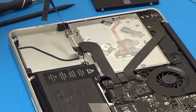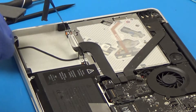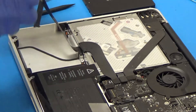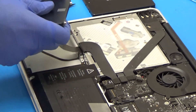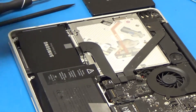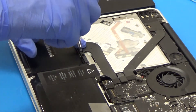In this case, we're actually going to be swapping out the solid state drive also. To do that, all you have to do is remove the Torx T6 screws — there are four T6 screws that need to come out, and it doesn't matter which order they go in. Now we have our screws back in, so we'll go ahead and plug in our data and power cable. Then we just put the pegs into the little holes in this bracket, and then the other pegs just sit down on the other side. Then we put our bracket back in — you'll be able to tell if it's in backwards because if you put it in the wrong way it just won't sit down in there, so you just flip it around. Then we'll just tighten these back up.